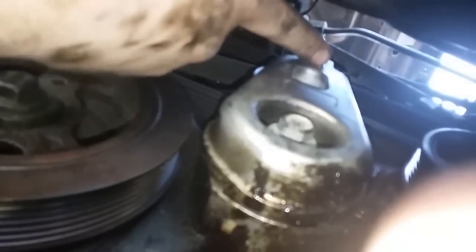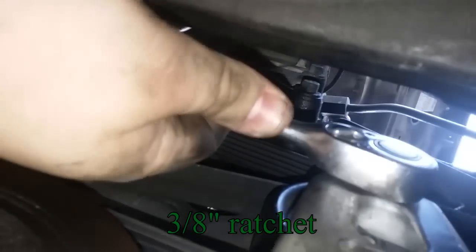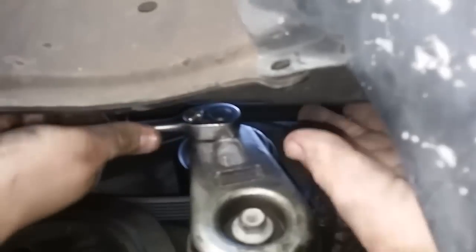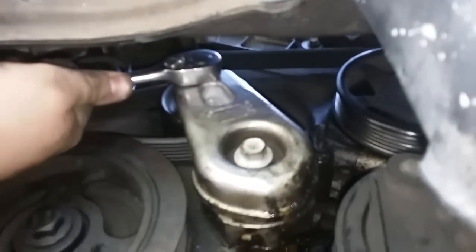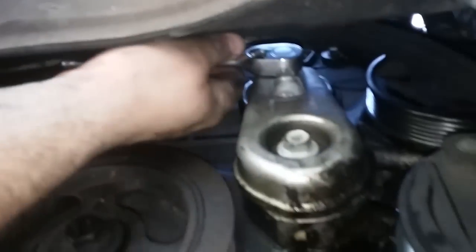Now, underneath here, there's this pulley right here. It's got a square in it right here. You put a ratchet in here to loosen the belt. And make the ratchet to loosen, and then you pull this, and then pull the belt off. You pull it like this, and then pull it off of one of these bottom parts. And then let go without it smashing your fingers, because the fingers can get smashed. And you can pull this ratchet out so you don't forget about it.